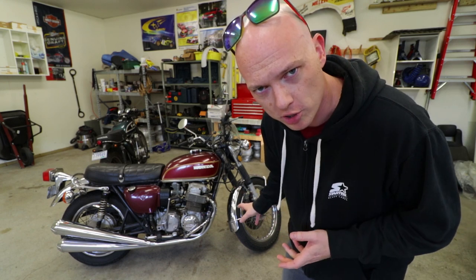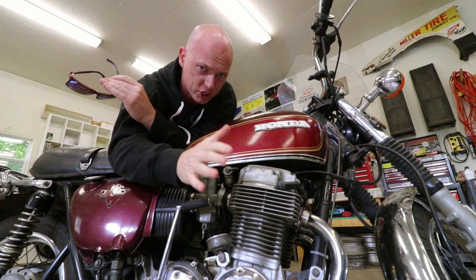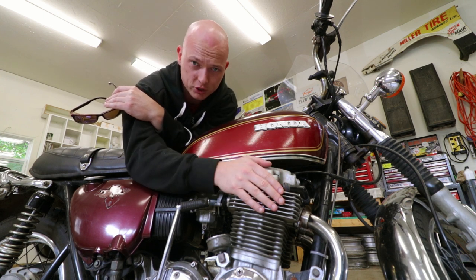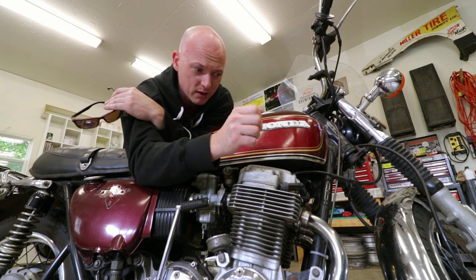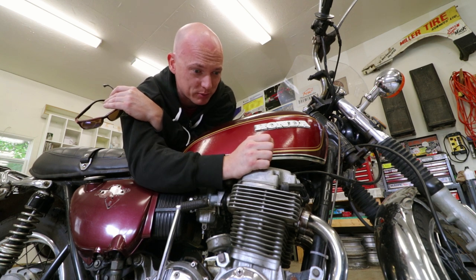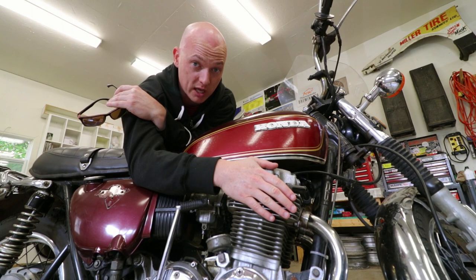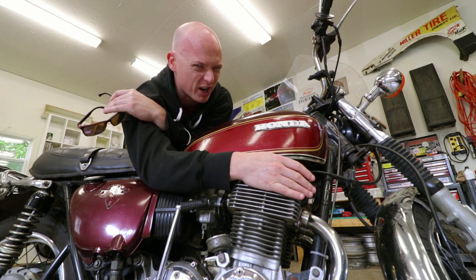Today, back on Project Raw and Burgundy. For the things we're working on today, you're going to want to make sure the engine is cold — no heat cold. The manual says to adjust the valves with it cold. With spark plugs, I've always found that trying to thread a spark plug into a warm engine can be a little bit of a recipe for disaster because things get awfully easy to cross-thread or strip threads. I recommend doing it with the engine cold.